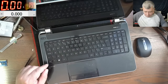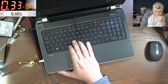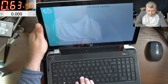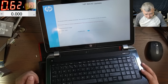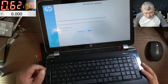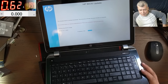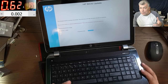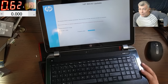Let's plug the USB and the charger onto the laptop — and we have picture! Check here — the fan is spinning at full speed. Keep in mind: the B key. It's writing a new BIOS image. It's pretty nice that HP did something like that. When you hold the B key down, the chipset searches on the USB for the BIOS recovery image. Pretty nice.